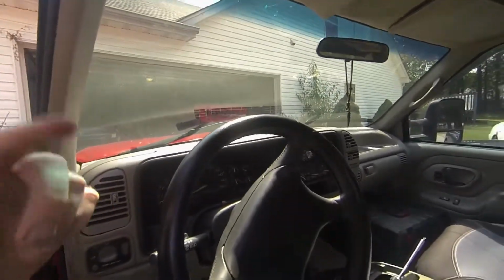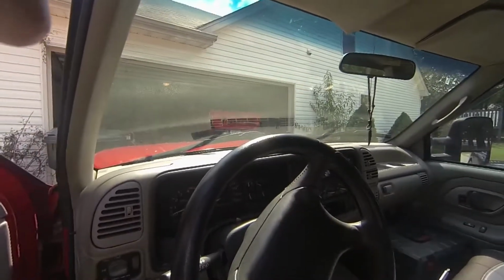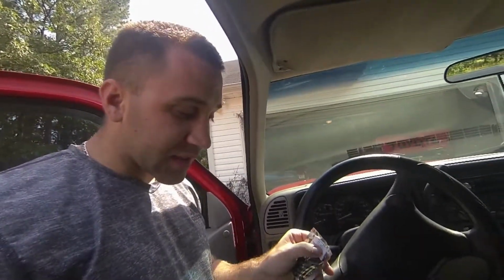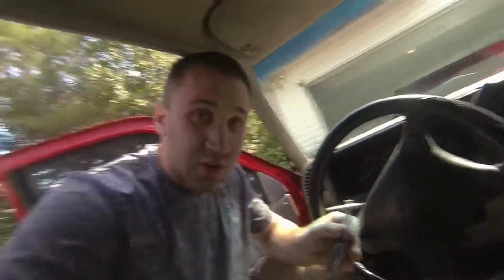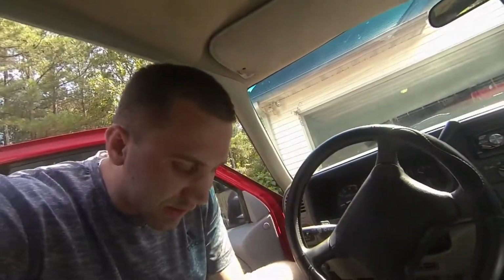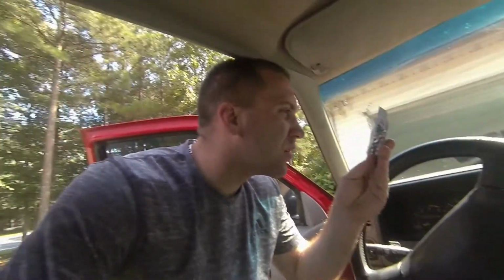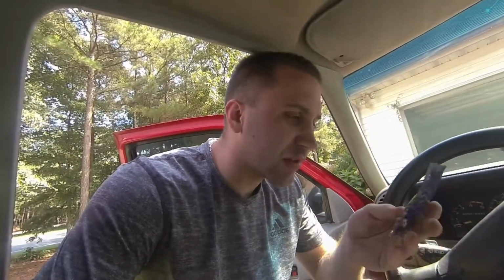Now I have blue 220 degree bulbs in there right now, and I've got a couple of flat spots or bright spots, hot spots they call them, right? And so I got a 360 one, but there's a big price difference between 220 and 360. These are about $6 a bulb, and I think I needed 6 of them for the dash, the instrument cluster. So you're going to be spending about $45 if you do this, 50 bucks maybe.